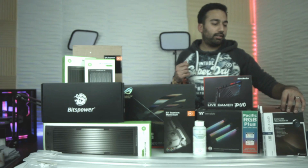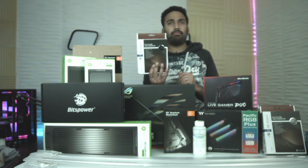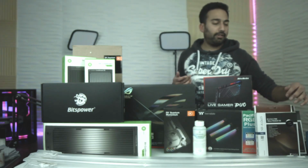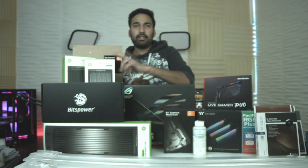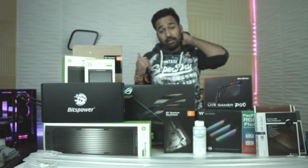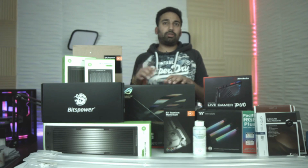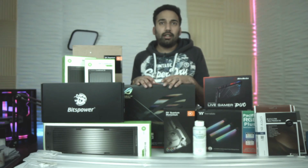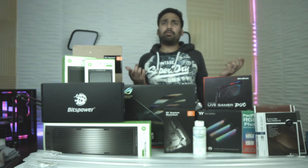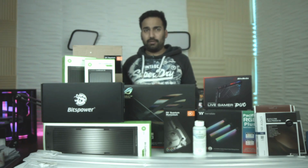So what we've got is these Noctua fans. These will go so that you can't see them. Obviously brown and beige, we don't want this for this build, but they're not seen. They're the 15mm fans. With that and this, it's enough to fit within the gap for the 011 Dynamic XL. It means that we can fit both of those and then screw in the other Lian Li fans. That way it fits perfectly fine, and it's only 25mm for the Lian Li fans and should be enough space to manage for this.